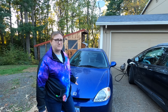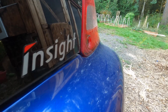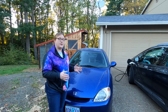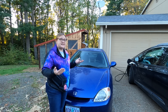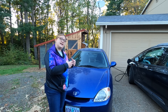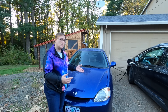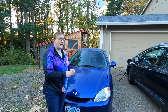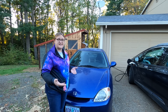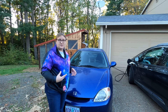Meet our currently unnamed Honda Insight electric project car. The Honda Insight is a particularly unusual looking car in terms of its shape and also in terms of its interior design, which I'll show you around in a minute. Originally, these cars had a three-cylinder one-litre engine inside, producing about 67 horsepower. And they were married to Honda's integrated motor assist, or IMA system, which was essentially an electric motor in series with the petrol engine.